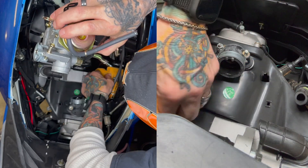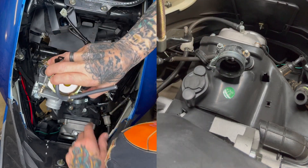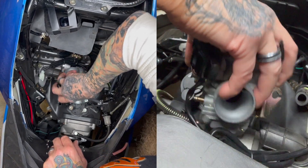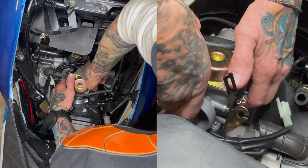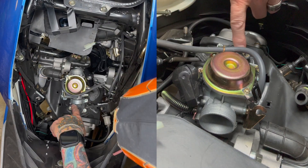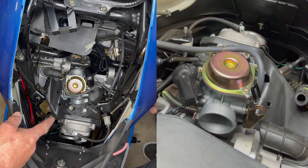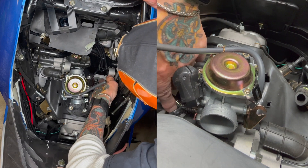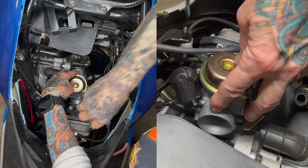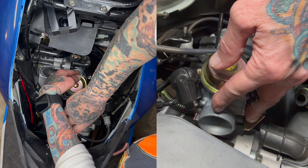So now what you want to do — it's got a nifty little routing point right there for your line. You can just run it right down through there and attach it on the bottom when you get ready. But now you just got to put this part back — wiggle it back in there, and make sure your choke line is out of the way first. Your little tab does need to line up — it's very important. Also make sure that line for the drain is not restricted or pinching into anything, because you might end up with the line draining since the petcock valve drain is on the bottom, as opposed to at the bowl with some other carburetors. I learned it the hard way.